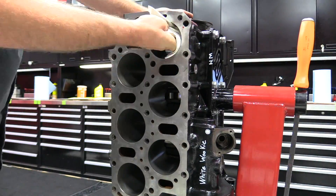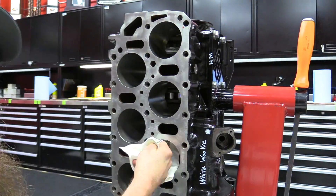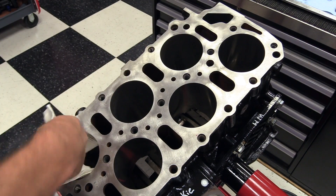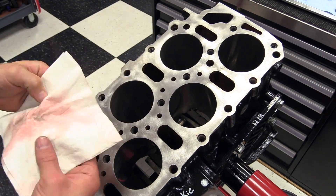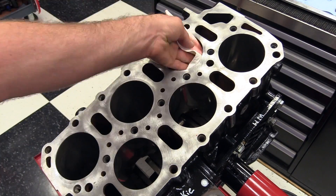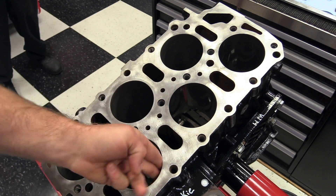With our pistons ready to go, it's time to go back to the engine block and work on the cylinder bore. We want to do another thorough cleaning of the cylinder bore with acetone — this is our last shot to get rid of any dirt or debris that may cause an issue with ring seating. Next, lubricate it with a little bit of Marvel Mystery Oil, which works really well because it's got some lubricant in it as well as some detergent. When doing this step, I recommend using a white towel — it'll show any leftover dirt. Finally, lubricate the cylinder with a bit of engine oil to avoid any dry movement of the piston inside the cylinder.